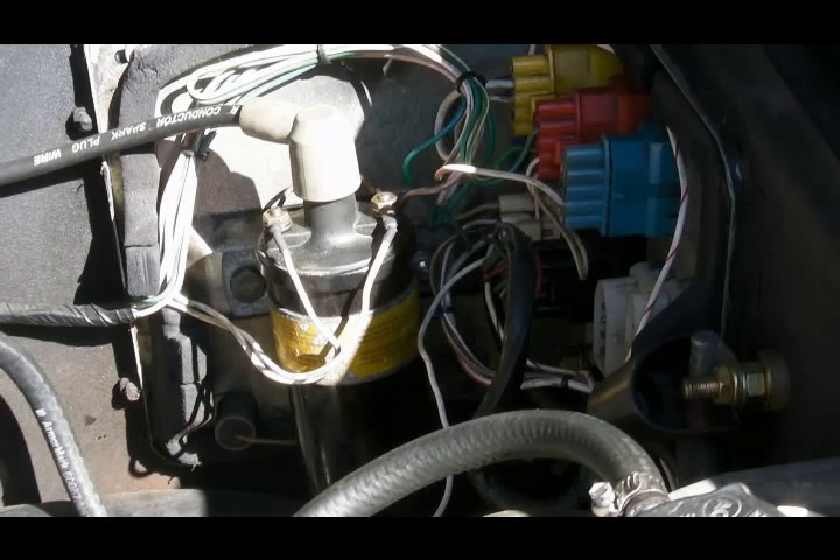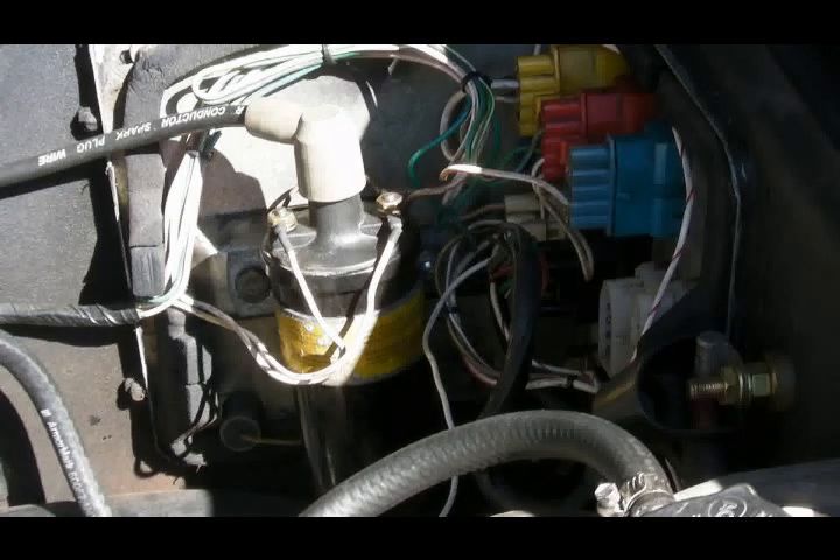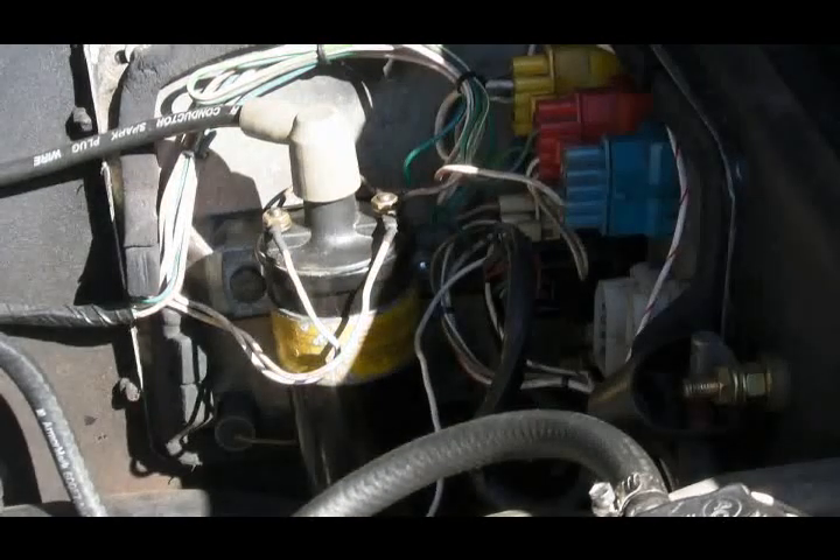One way you can do it is to put a small gauge wire in the white bulkhead connector that has the two white with red wires coming out of it. It needs to be a relatively small gauge wire — 16 to 18 gauge — because it's a pretty full terminal already with those two wires hanging out of it. Just put a wire in there, turn on the ignition, and then touch the jump start post. If the engine starts, obviously the starter motor and the battery are fine.